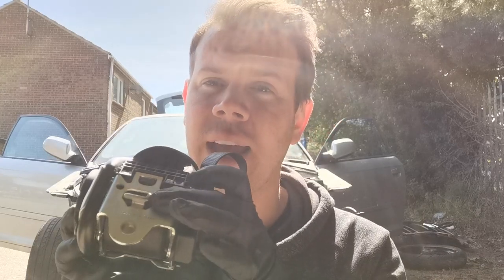So you need to go get your new one. The way to tell is this is the new one — shaking it like this, absolutely no noise at all. With that you know this is absolutely good. Don't be alarmed if it doesn't retract because these have to be in a certain position in the vehicle for them to actually retract out. Don't think you've bought a dud one — just go put it into the vehicle, locate it with the lug, and once it's screwed into place and parallel, it will come out absolutely fine.